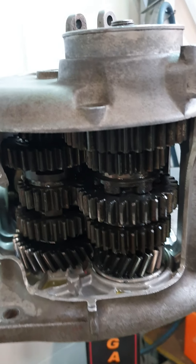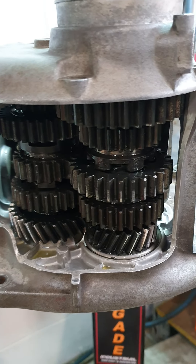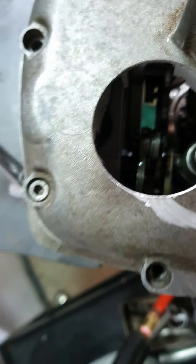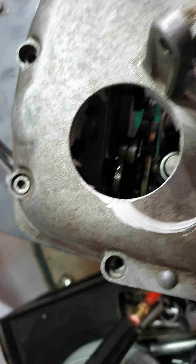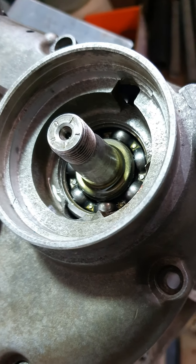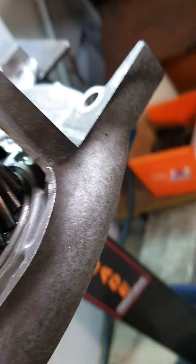It shows the workings of everything: the shift cassette, the shift pull, the intermediate and output shaft, the input shaft down through here. You can also see the shift cassette through there, that's the output shaft and the smaller bearing on the output end.